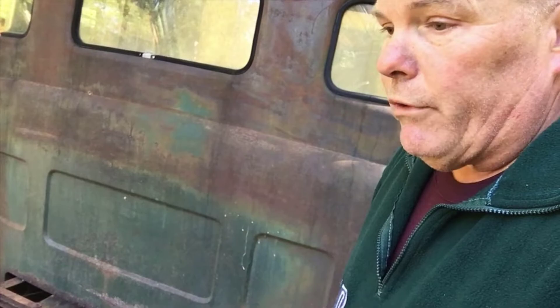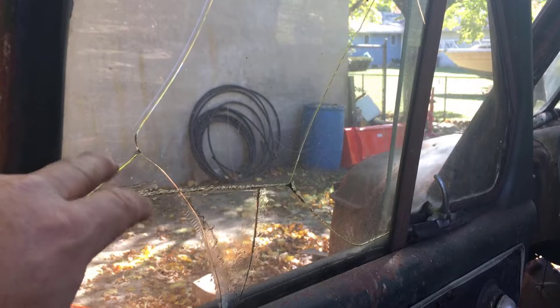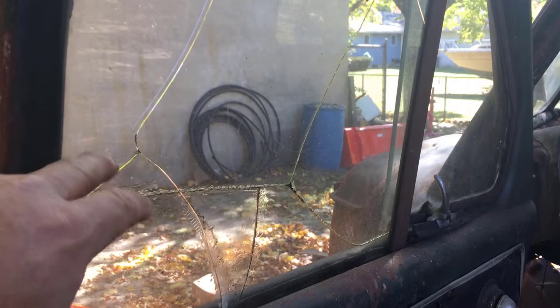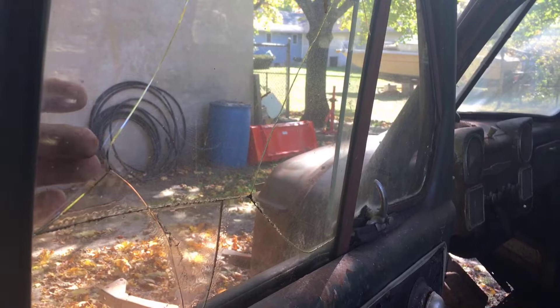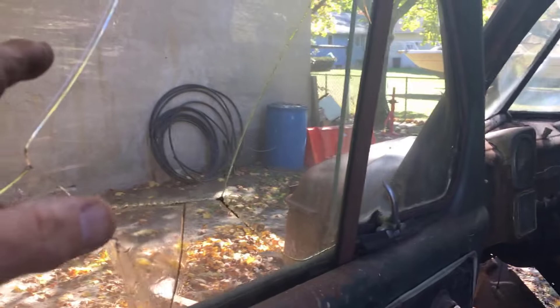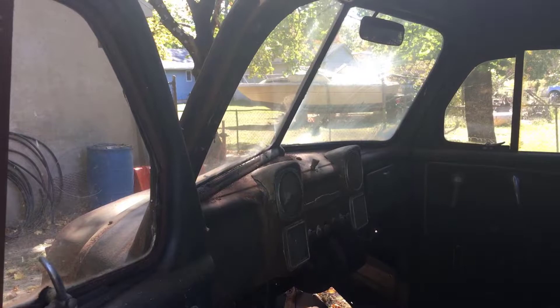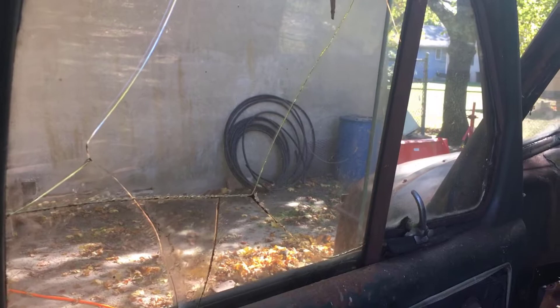I've never painted anything before so I can't really tell how it's going to come out, but hopefully it'll be pretty decent. Just a little side note on the glass: back in the '50s and earlier, they didn't use tempered glass. This being a '53, it does not have tempered glass — you can see how it's cracked in big pieces. If you were in an accident with this type of glass, it could really cut you up. Nowadays it's tempered — if you've seen one break, they go into tiny pieces. The windshield nowadays is laminated so it won't cut you up as bad. A lot of good safety improvements have come along regarding glass.